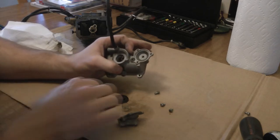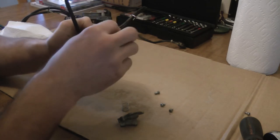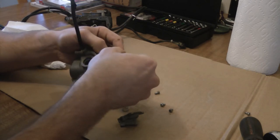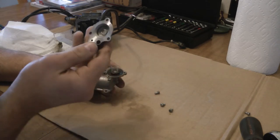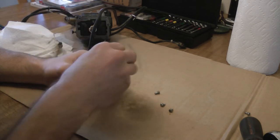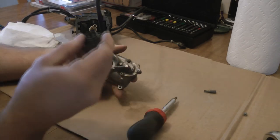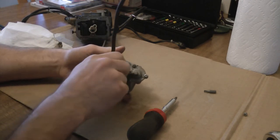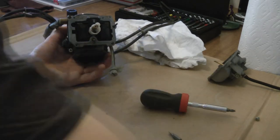It's all cleaned up. Now put it back together. Make sure that O-ring is still in there. Your diaphragm — put it in the right way, make sure it's seated in there well. Don't forget your spring, and then your cover. Make sure the O-ring in there is still in there and still good to go. If so, you can go ahead and toss the plug back on. We've got the bowl all taken care of now.